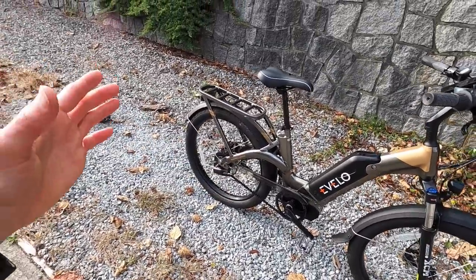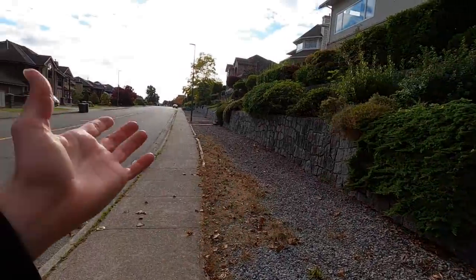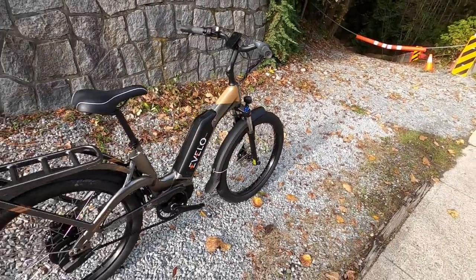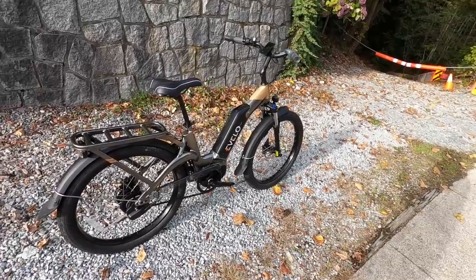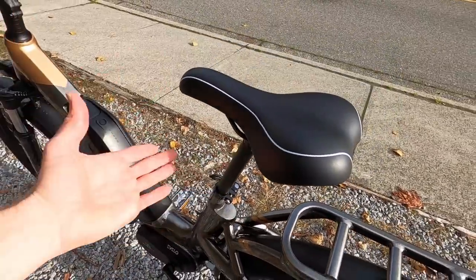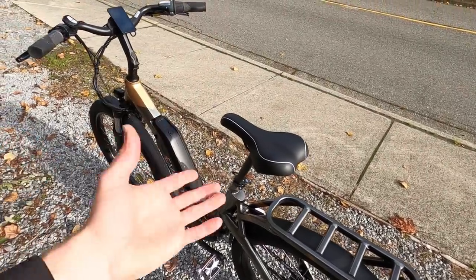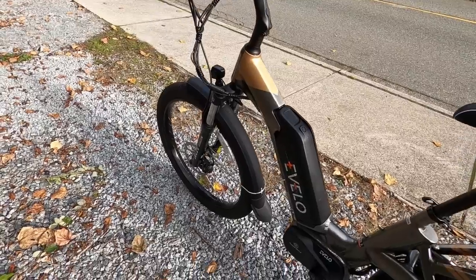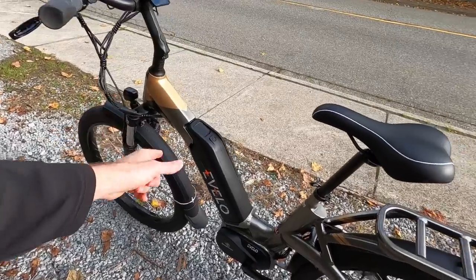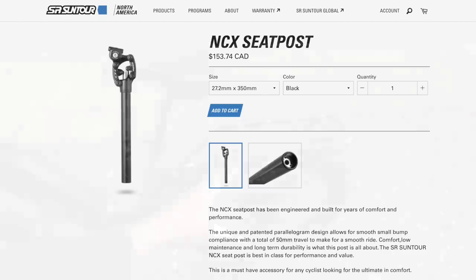Overall, the bike is just fun to ride. It's more of a casual, lower-cadence experience — good for neighborhoods with just a little bit of gravel, maybe some trails. Having that through axle is almost like overkill, but I'll take it — it's a pretty sturdy bike. 27.2mm seatpost, 350mm long, so you can raise it pretty high. I think this bike would accommodate many different body types and heights. The suspension fork is nice at about 100mm travel, and with that seatpost you could swap it for a suspension seatpost and get that full suspension feel, especially with the bigger tires.